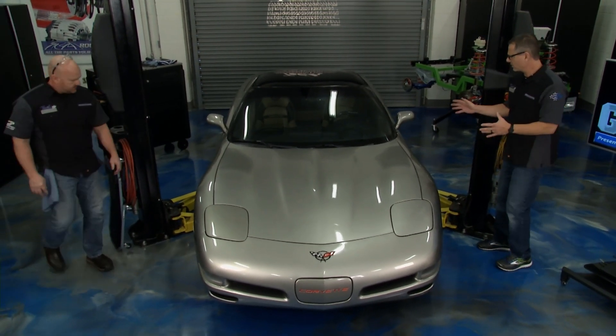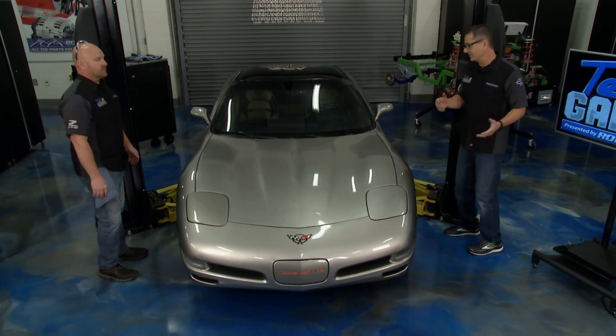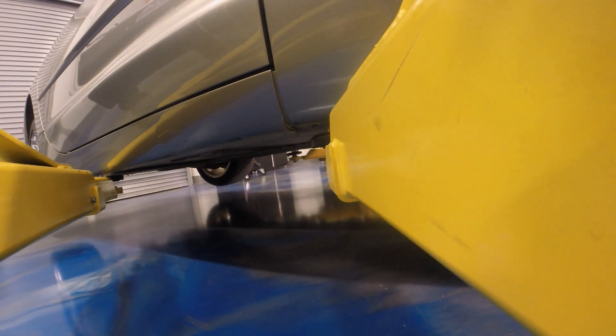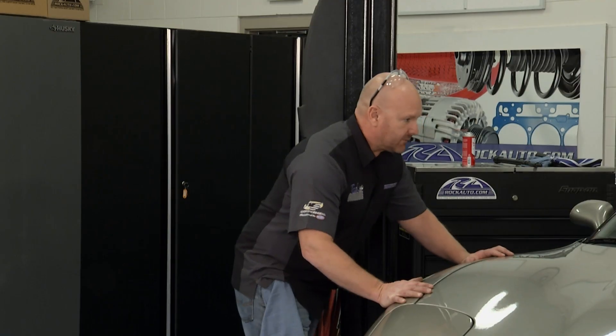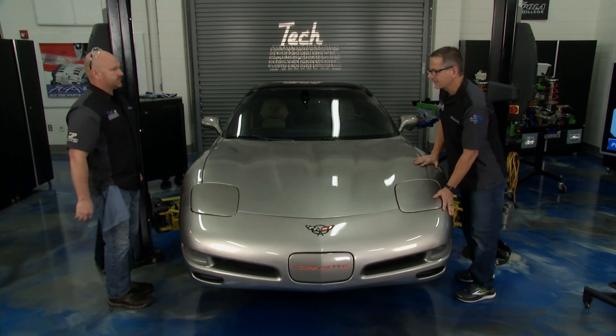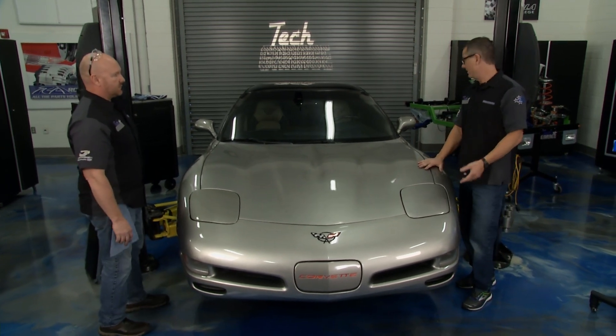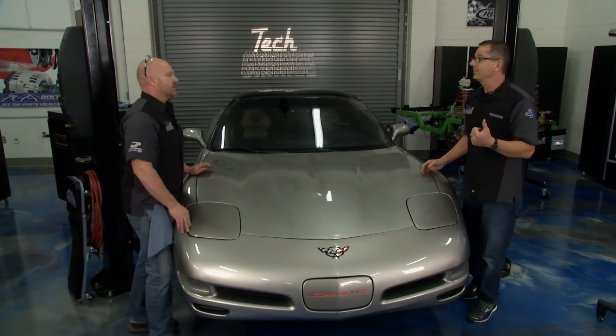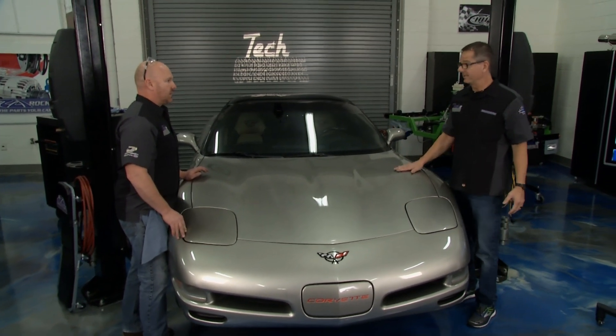Make sure you're under some metal. Make sure everybody's safe and clear, doors closed. A lot of times I take the key out — some of these cars will lock automatically. I'm going to lift it about six inches off the ground and then give it a little shake. Don't be afraid to shake it — that's where you want it. If anything's going to go wrong, it's going to go wrong here. It's in good shape. I'll take a look at the lift points while you get it up in the air.